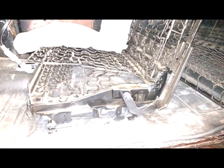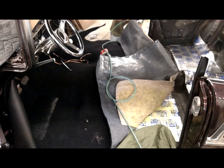Next, we start with the floorboards. From the base floor to the solid steel floor, once we install the sound deadener, we are actually going to start installing the carpet. In this application, we used a one-piece molded carpet made for this vehicle. Has the sound deadener and also the jute padding underneath the carpet. There is trimming and modification required. It is not just a drop-in application. We do have to steam it and heat it, and it is glued down in spots. The finished product is a very nice finished look.